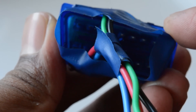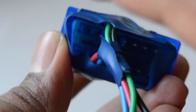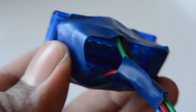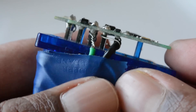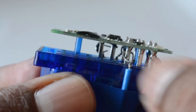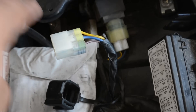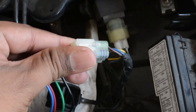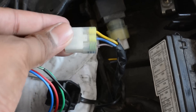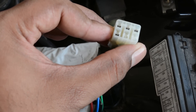The bigger side is the top row and the smaller side is the bottom row. Both have the same number of pins, so the shape is given to not confuse you. Here pins 4 and 5 are ground, and pin 3 is CAN plus. Coming below, pin 1 is plus 12V and pin 3 is CAN negative. So you have to connect these corresponding pins to the KTM OBD2 port. Just a little note — the pin numbers I just said are not from the pin configuration diagram but from my point of view. The KTM OBD2 port under your rear pillion seat will have 6 terminals, of which only 4 will be connected to wires.